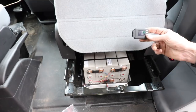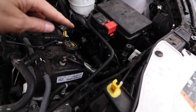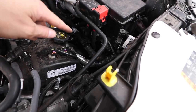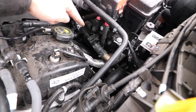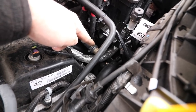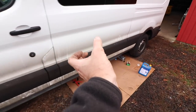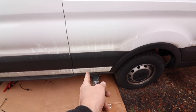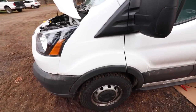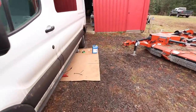The best part though is the heat exchanger - I'll show you how I tied all that in. Let me take you into the engine compartment. Essentially we're using the hot water that the engine is producing to help with that hydronic furnace. This is the line coming out of the heater core, and I took that line off and spliced in a 90. So we've got two heater hoses running all the way back - 30 feet, 15 feet each way back to the heat exchanger. I've essentially extended the loop of the cooling system 30 feet.